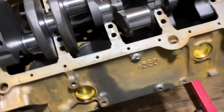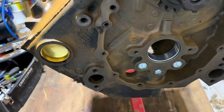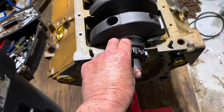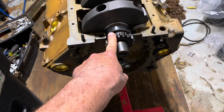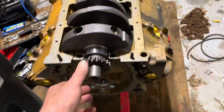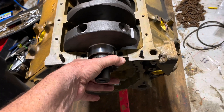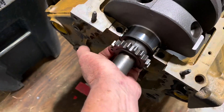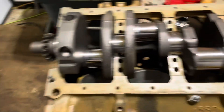I'm not sure about that because the bolt pattern for the front timing cover looks to me to be the old stamped-steel type. I'll have to get the cover and check the fit. I'll also be replacing the gear that came off the core engine — pulling this gear off and putting on a roller timing chain instead. I use what MerCruiser uses on their engines: a 3/8-inch wide roller timing chain.